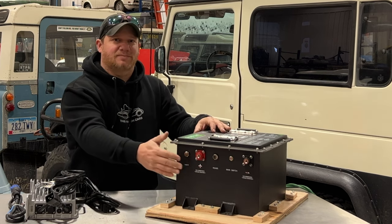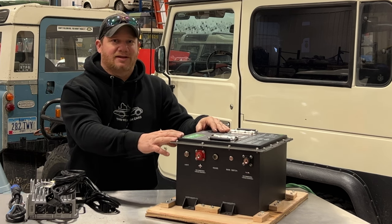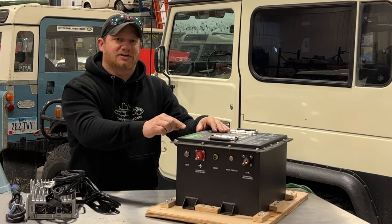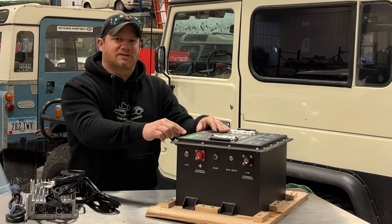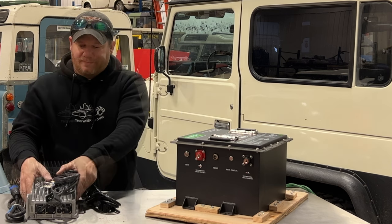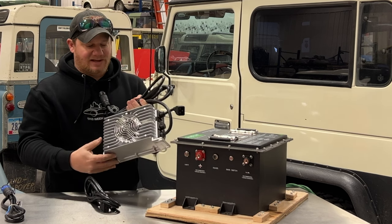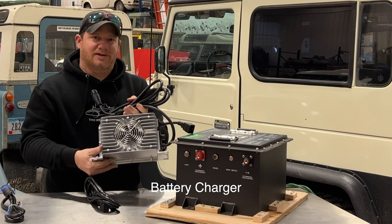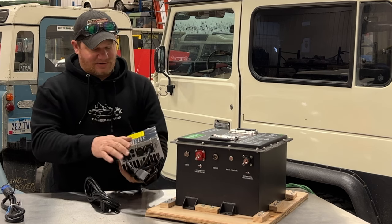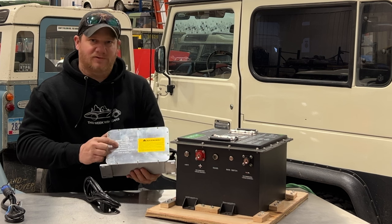After installing the battery and hooking up the outputs to your motor and inverter, you're going to need a way to charge the battery. You could use the charger built into your golf cart and have it reconfigured to charge a lithium battery, which needs a higher voltage than the lead-acid batteries did. But I would suggest getting a battery charger from RoyPow. This is the charger that goes along with this battery — it looks a lot like the Thunderstruck charger I put in my electric car. It's really heavy and seems like a very nice unit. On the back it says it outputs 43.5 volts at 22 amps.